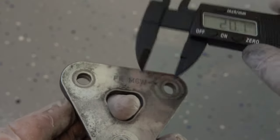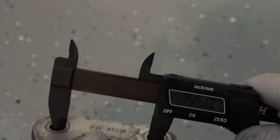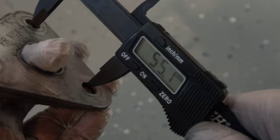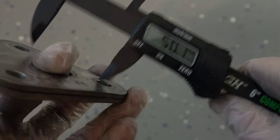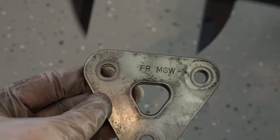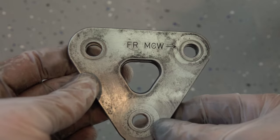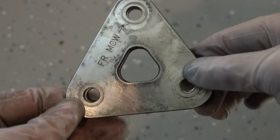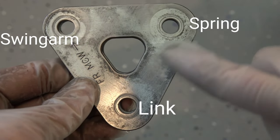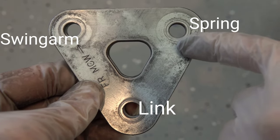I'm going to show you this. This is how they're positioned on the bike — I take a measurement and it comes out to 55. I rotate it and take a measurement — that comes out to 53. And keeping that orientation, I take one more measurement — that comes out to 50. So five millimeters less. This is how they sit on the bike. The hole positions with the shortest distance are the ones holding the chassis and the swing arm together.